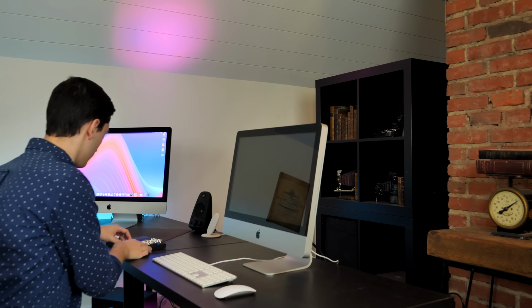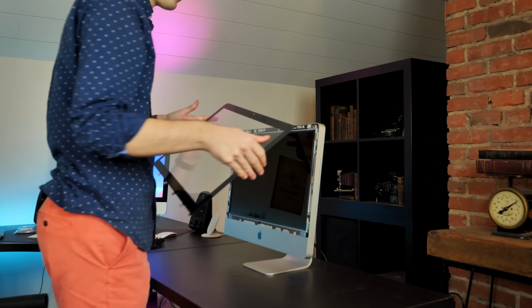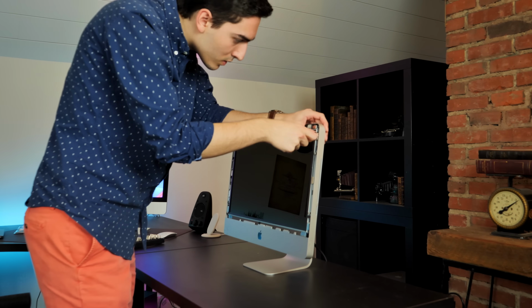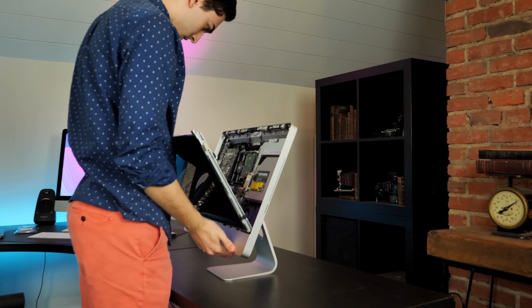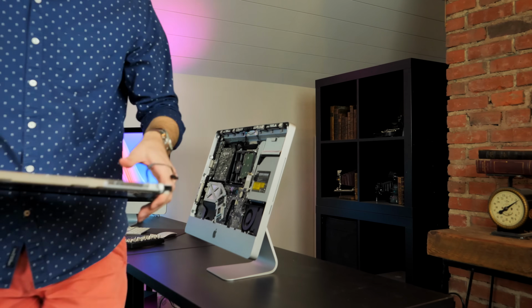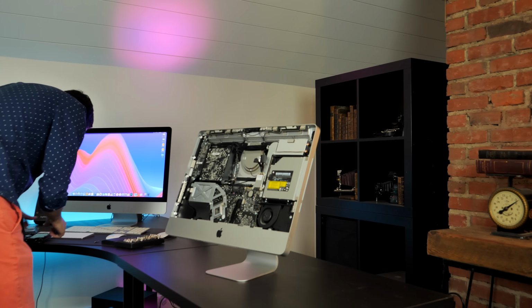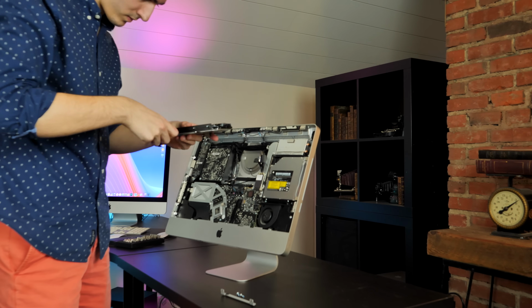With just $100 to spend in upgrades, I decided to start by tackling the RAM and storage. I picked up a cheap 240GB SSD for $24 and snagged two 2GB RAM chips for $8. Because this iMac has 4 RAM slots and had 4GB in it already, I only needed to buy an additional 4GB of RAM to bring us up to a very usable 8.